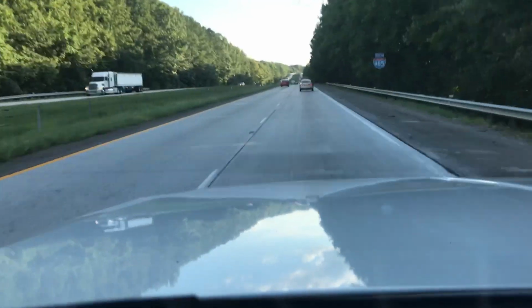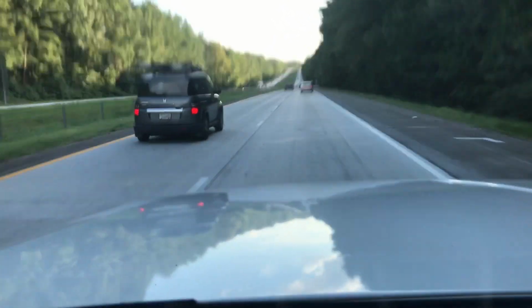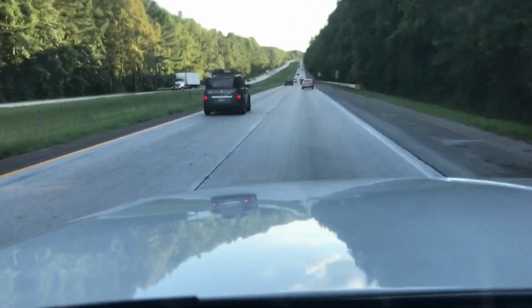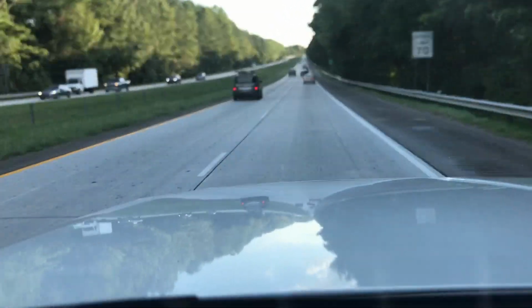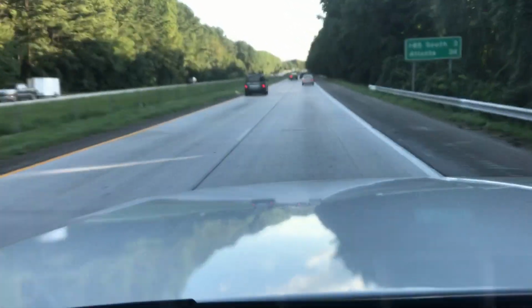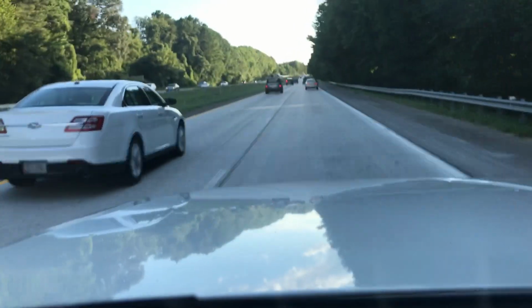Alright, going freeway speed. Hopefully the pavement will be smooth enough that it won't knock my phone over. But I put the rest of the jar in there. I had 6 ounces there before. I put about 6 more in, around the same amount, so I have about 12 ounces in each tire now. It shakes a lot less. I'm impressed. It doesn't do it around the sweet spot anymore. It goes around 40, 45, and it'll go away around 50, and it's pretty much smooth all the way around.